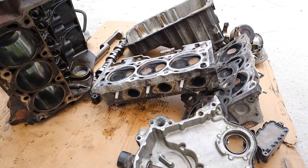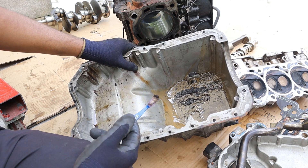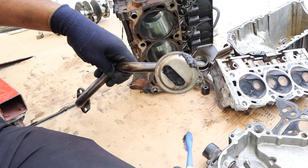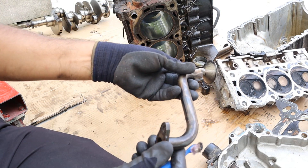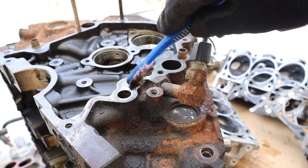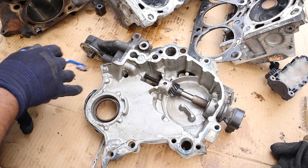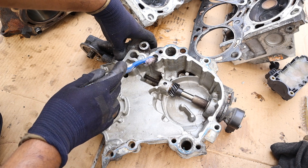Let's take a closer look at how this Ford Mustang engine works. Starting at the bottom here we do have a cast aluminum oil pan — very simple design, nothing integrated inside. It is fairly strong although these are more brittle than a stamped steel design, but at least they won't rust. Next up we have a really long oil pickup tube and you can see it's seen better days. This little screen here is all clogged up from a lot of junk and sludge as well as the oil and coolant mixing together from that head gasket failure. The oil pickup tube is going to bring oil to the bottom of the block and then out to the oil pump assembly which sits on top. Here's a look at that oil pump assembly which is actually part of the timing cover — oil comes in through here, gets filtered out over here, and the pump assembly is integrated into here.